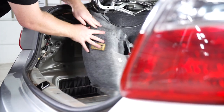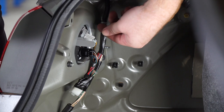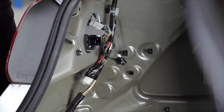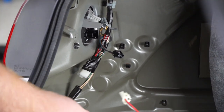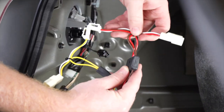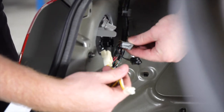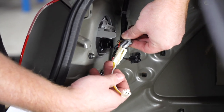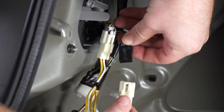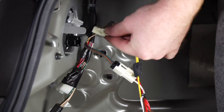On the driver's side, we'll pull back our lining and that gives us access to the tail light. We're going to unplug each harness from the tail light, then take our yellow T-connector and our red and brown T-connector. We'll plug in our gray tail light harness into the yellow T-connector, then take our red and brown T-connector and plug it into the black tail light harness, and plug them back into the tail light.